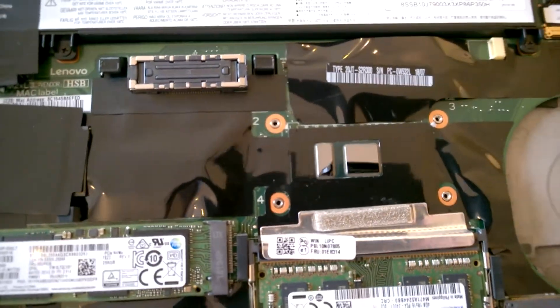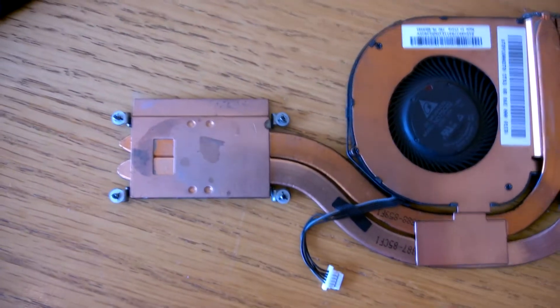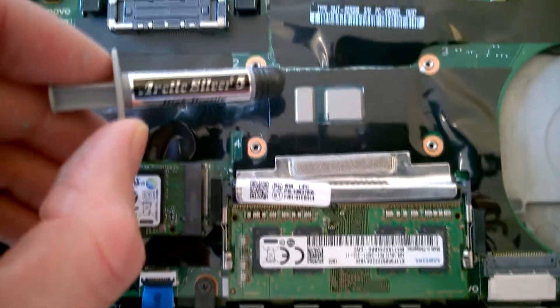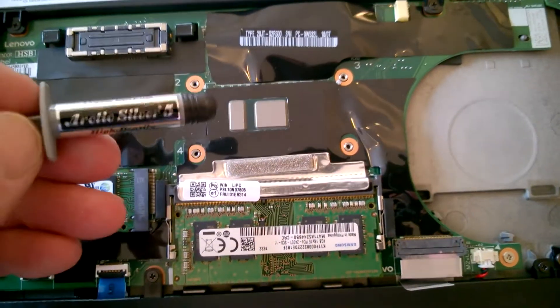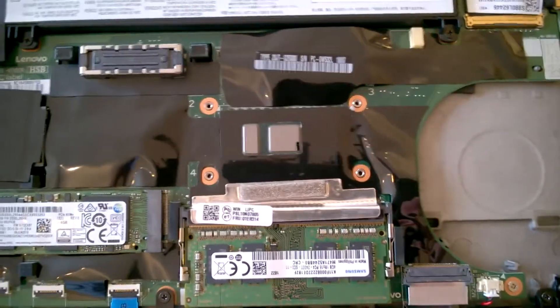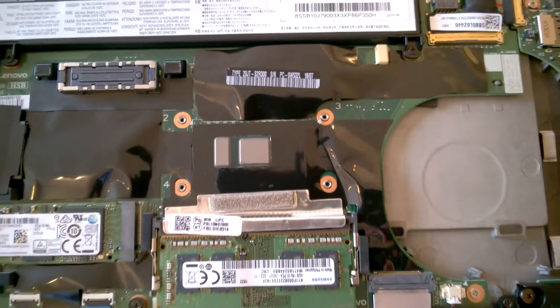Okay, so nice and clean — you can see that's lovely and clean, no bits there, and same with the heatsink. So what we're going to do is apply Arctic Silver — just happens to be the one I use. There's plenty of others out there, but Arctic Silver 5 is pretty good stuff, I've used it for quite a few years. Don't need very much at all, just a light coating really, and then we'll stick it back together.